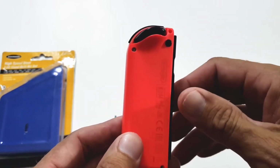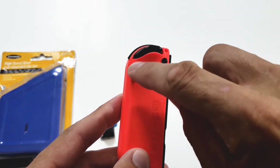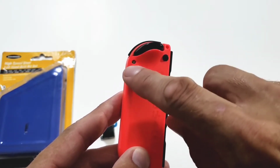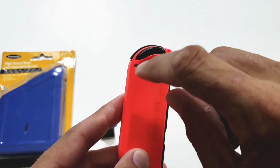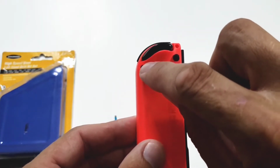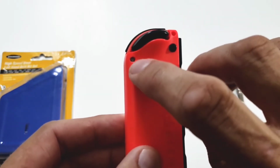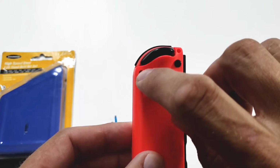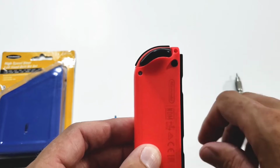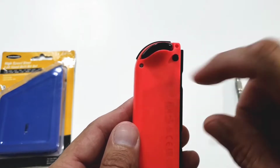So I went on YouTube, and some of the videos that I saw were mainly either drilling out this head or scoring this with a flathead in one direction over and over until you create kind of like a cross, and then using that flathead to remove that screw. There was also a guy that had a very tiny rotary wheel, and he had a magnifying glass hooked up to a TV, and he managed to get inside of this hole with this tiny wheel and create a slot that he was then able to get it out with a flathead. But I wasn't too crazy about all those methods, and I definitely didn't have a grinding wheel that tiny.